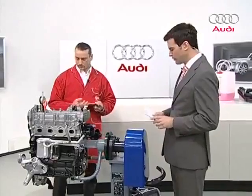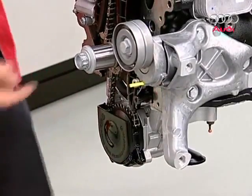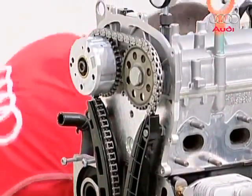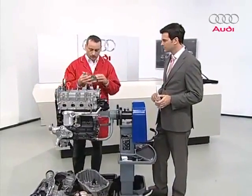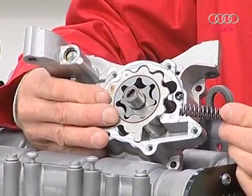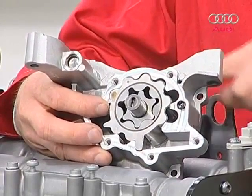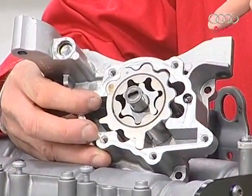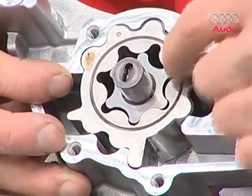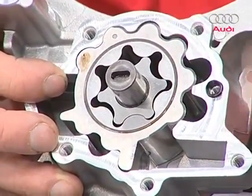Let's look at the oil pump — a so-called regulated oil pump. The oil pump is down here; when you remove the oil pan you can see it hanging from the engine, fastened to the block and driven by the chain drive. I took one off another engine and opened it up. There's an extra regulating spring here. The input shaft and inner ring are firmly attached to one another and propel the outer ring — that is basically the oil pump as we're accustomed to. The space expands and contracts, drawing the oil in and compressing it to circulate the oil.